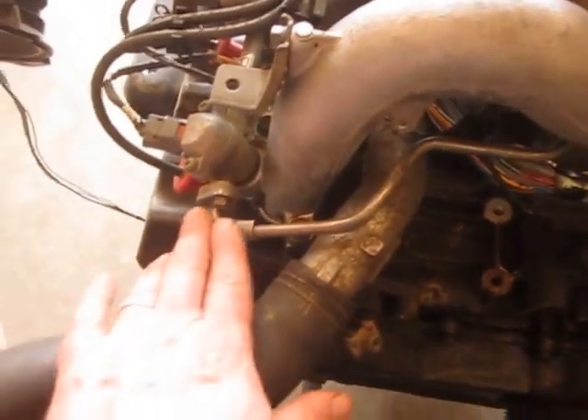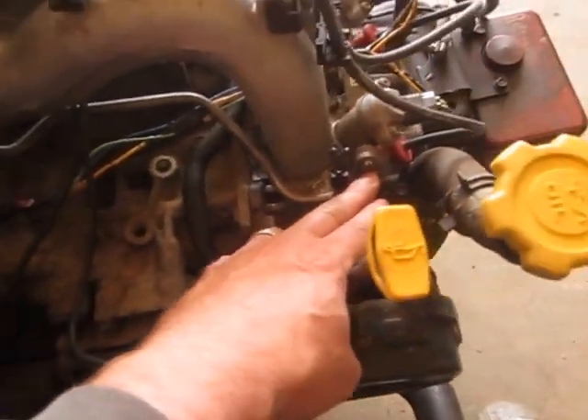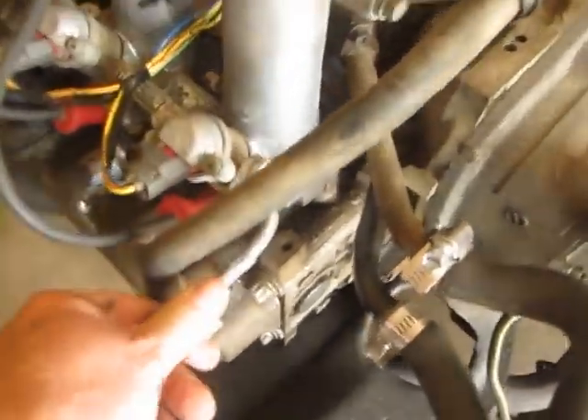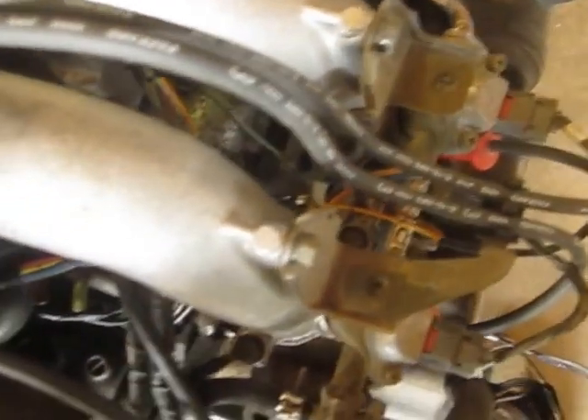A few of the little modifications we do for the fuel rail. We keep this front fuel rail that goes all the way across and then we make it so there's only the fuel inline, and then on the other side off the regulator is the fuel return line, so you only have the in and the return to get rid of all the other fuel lines.